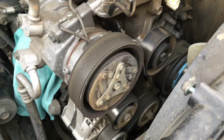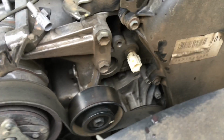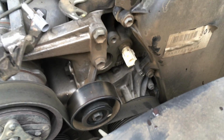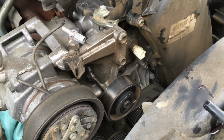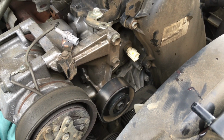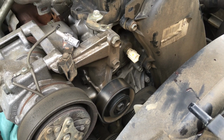And that's why you do the water pump when you do the timing belt, because sometimes they're a 1-piece unit like this. And we converted over, as I've said before, to a 2-piece pump, and you've got rocks in your head if you don't. If you saw that video we put up the other day that showed that water pump that had completely collapsed, I suppose that's enough evidence. You know, 150,000 Ks in my book is a long time, and it's a small amount of money to spend when you spread it over the period.